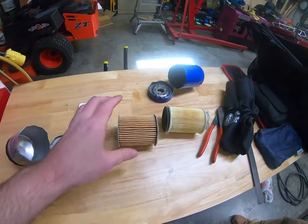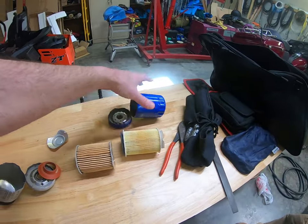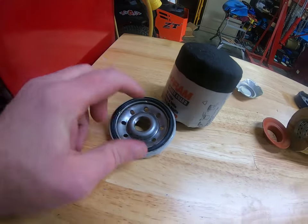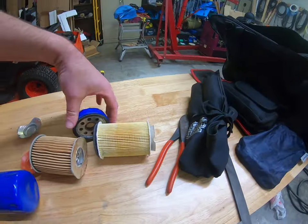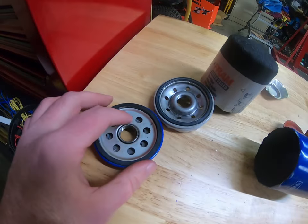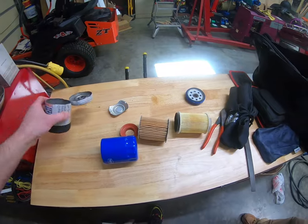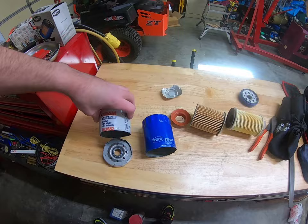There are differences between these filters. This one is actually tougher to cut apart and it feels heavier — I think it's just that the metal might be thicker. Plus the bottom of it, if you look, this one is concave and it's really thick, where this one is flat and the metal itself is a lot thinner. So there are differences internally between what I call a house brand or store brand filter and the mid-level Tough Guard.